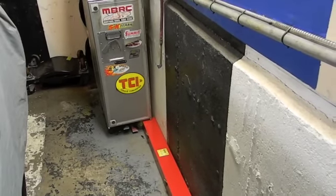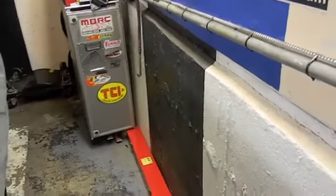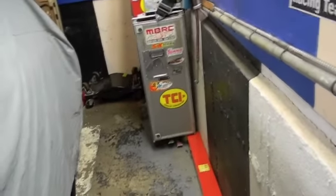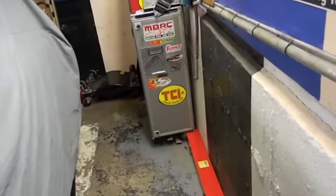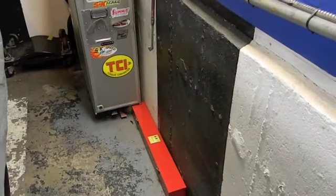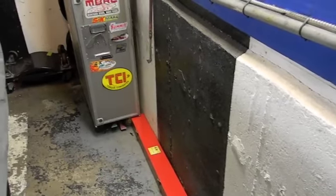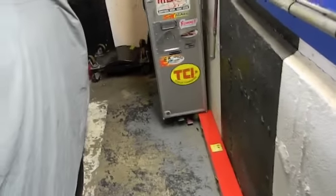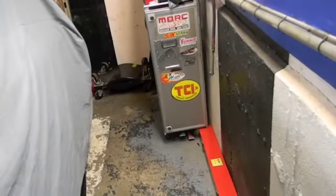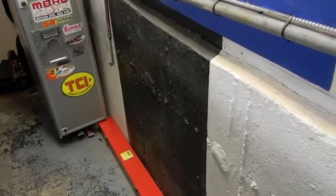I would say if it was buried into the tranny, you'd have to cut 1 inch off, so maybe even more than that. We'll get under there, we'll do it, we'll figure out the length, but I gotta get the U-bolts on for that. Tomorrow I'll just bring that companion flange to work, and I'll press the universal out of it. I gotta make a decision if I wanna use my shaft or get a different shaft. Something a little beefier, and just do it all in one shot. Got a little time to decide.